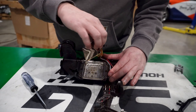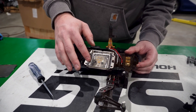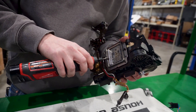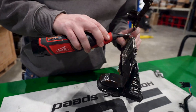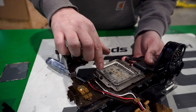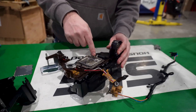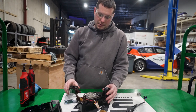Just peel it off, then use the other rotary tool to deburr the edge because there's a whole bunch of metal. You're going to get all sorts of metal inside here — not a big deal, we'll blow it out. Make sure there's nothing hiding under any of the pins because they're all mushroom-shaped, so things can hide underneath them. It isn't world-ending if you nick a few pins because we have to clean the tops of them off anyway. Just make sure not to hit them too hard because they can bend. After this, blow it off again, brake-clean it. You can get brake clean in here — you're not going to hurt anything. Then we'll go back and cut all these wires out and start soldering in the board.